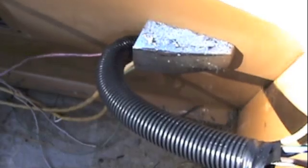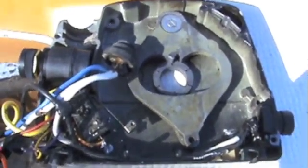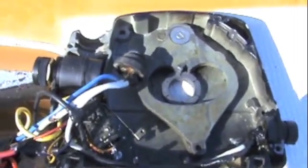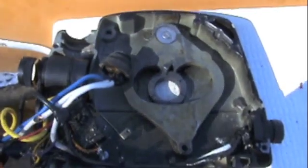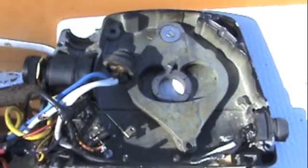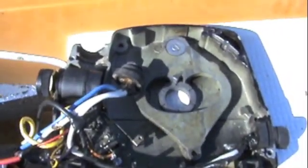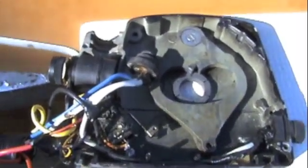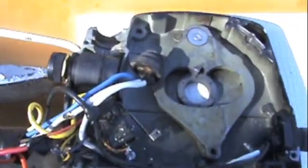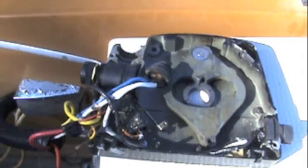It's got these little prongs that you can push the wires behind, and you just have to get it back the way it was, or as close as possible for everything to work in there. Hopefully I'll have this done today — go ahead and get my battery in here, hook it up, and see if I can get this engine to crank over and see if it's got spark. I was going straight to the starter with a battery thinking it would get spark, but it won't, because the solenoid isn't getting power to send spark to the spark plugs. I had to get all this rewired just to even test that. It's been quite a few days of messing around, but I'm saving myself a ton of money. I appreciate you watching — please comment, rate, and subscribe, and let me know if you enjoyed these videos. I hope it can help you out in some way. Thanks.